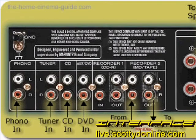Now that we've talked about the numbers, let's talk about functionality. This is a great graphic from homecinemaguide.com, and it shows the basic inputs and outputs on the back of an amplifier. We know this is an amplifier and not a receiver because there's an input for a tuner. Starting on the left, we have a dedicated phono input. This input is designed to take the low-level signal directly from a magnetic phono cartridge — it provides special amplification and equalization that a turntable needs. This is a dedicated input and can only be used with a turntable. Plugging a CD player into this input would produce a very loud and very distorted signal.